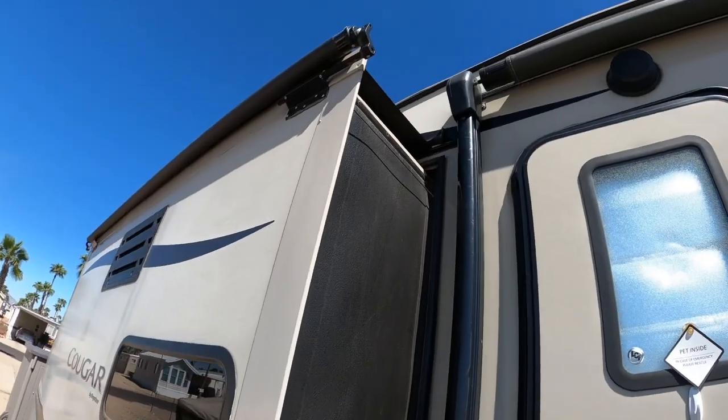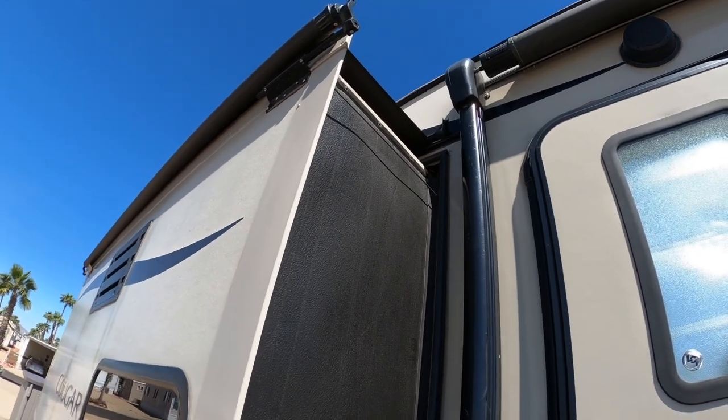The biggest problem I've seen in watching other people do this job is they either use tape and use too much tape and it gets stuck, or they don't use any tape at all and it comes apart before it slides through. Once that cable goes through the wall, you're pretty much done. If you have to feed it through manually without the old cable, it is far more difficult. Trust me, I had to do that before. So let's go ahead and get things prepped and ready to go.